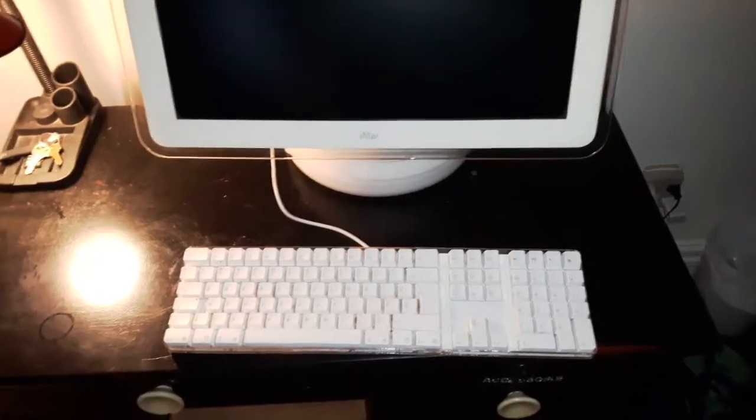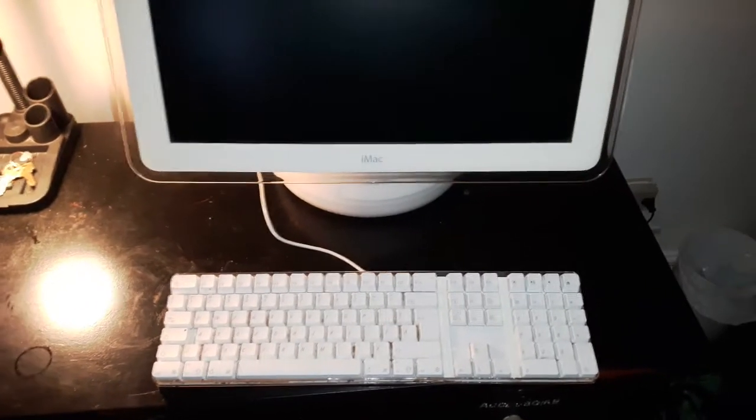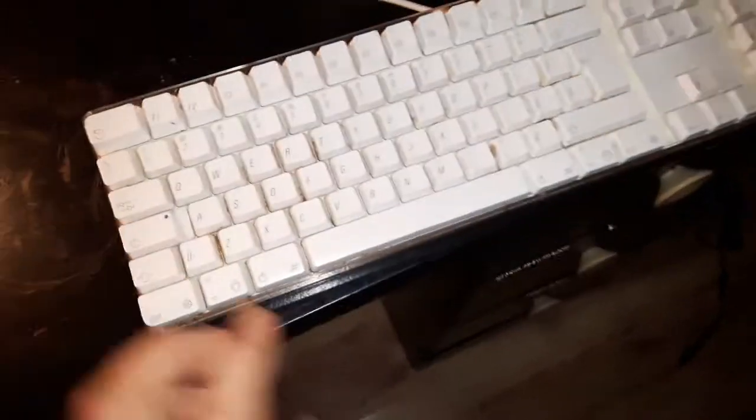You see now everything is working, but let's say it was not the case. So, I formatted, it's supposed to work. Don't forget to take the PowerPC version for the G4. It's 32 bit. So I press power on. I hear the sound. Press and hold Command, Option, O and F at the same time until something happens.